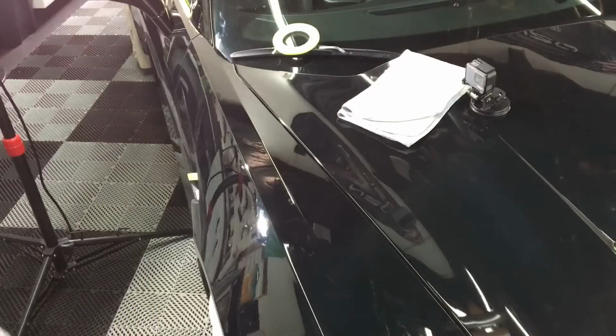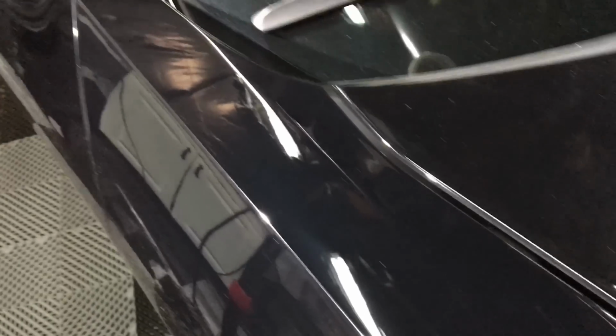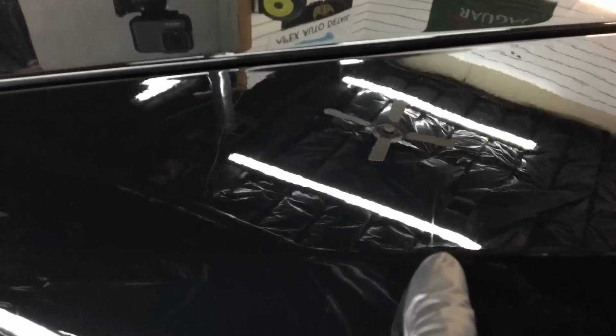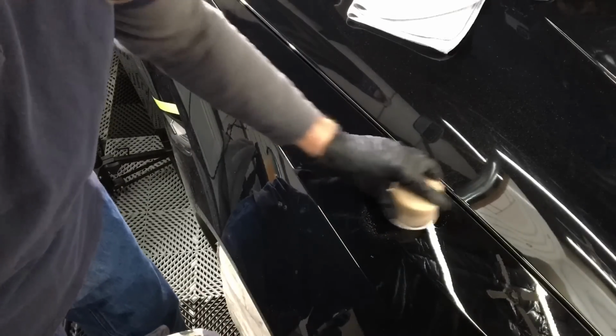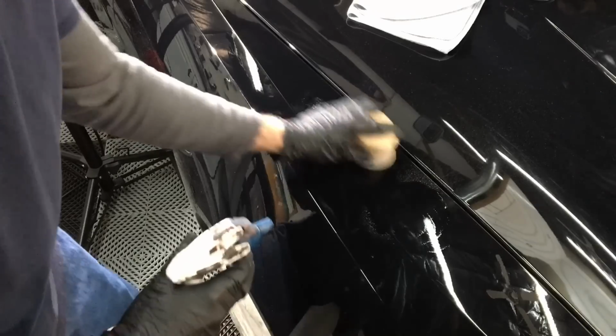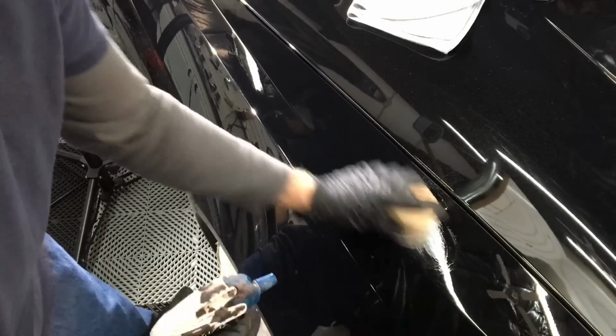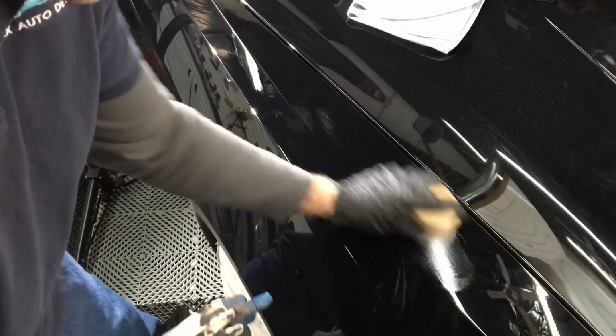Again, keep in mind, if you haven't been following the series, we're just cutting with 3D1 on this hard, stubborn clear coat here. So very impressive job by 3D1. Yet again, I can't stress enough how much that will help you. I found that by accident just testing, as one of you guys recommended 3D1, and I really wasn't a big fan of the spider pads. I'm still not. You don't see me using really anything else from 3D, but 3D1 and 3D ACA are a staple here when it comes to paint correction. So I did find a couple spots left over that the 3D1 couldn't take care of, and that's been happening. So I'll come back then and correct that with 3000 grit and, of course, the Trizact disc.